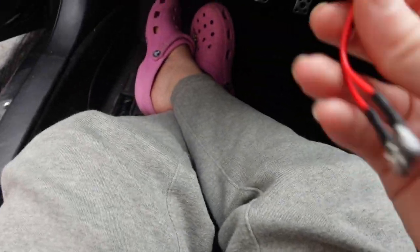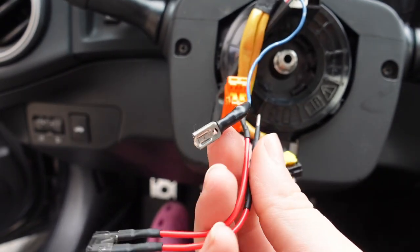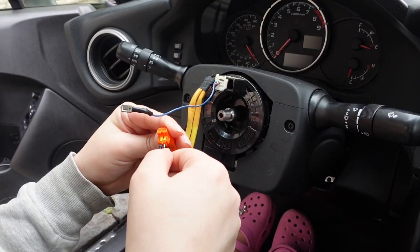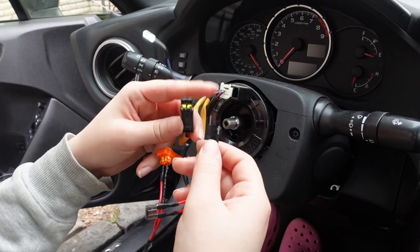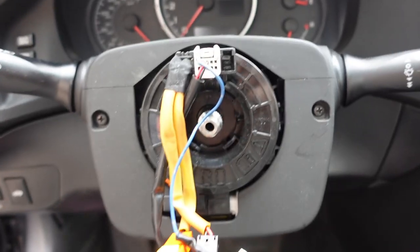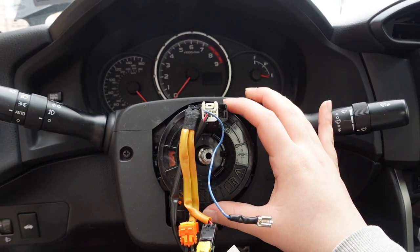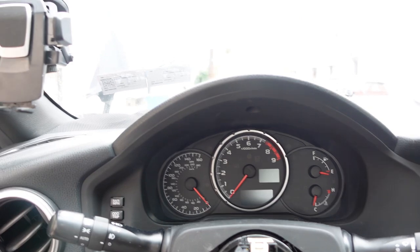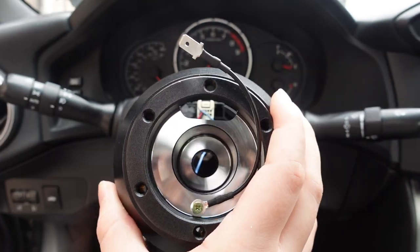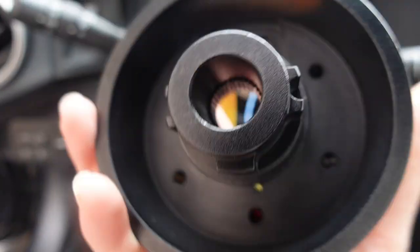The short hub comes with these little wires, and those two little holes — we're gonna put these two wires in. The same thing with the other one. This is for your airbag so that the light won't show up on your dash. You've got to make sure this is straight because you want your steering wheel to be dead straight. Once you're sure it's straight, you want to make sure the back end matches — this back end is the top right here.